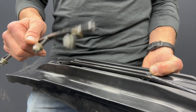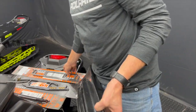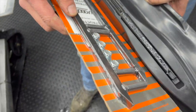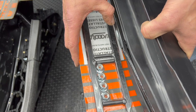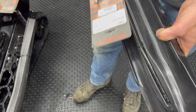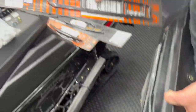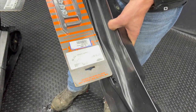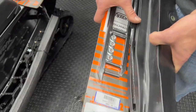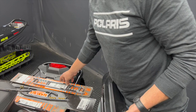The common is four inch. This is called the host bar, and the diameter of that bar makes a difference in how much bar you have beside the carbide. All the carbides that go under this Pro Steer ski use the same size bar — it's just a matter of how much carbide you want. Now there's also the ACE bar, which is a rectangular bar. When that goes in there you've got a square wall before you get to the carbide, it's deeper, and it lines right up and drops right in to give you more rudder.